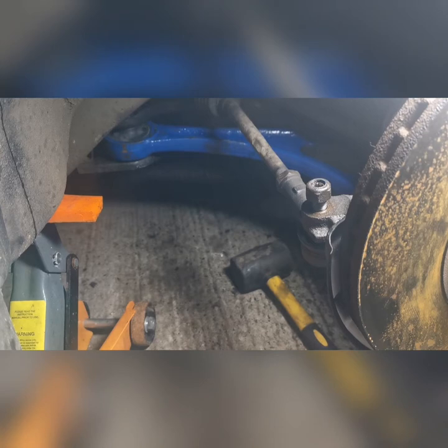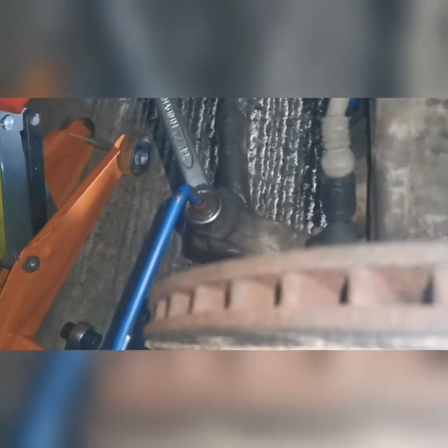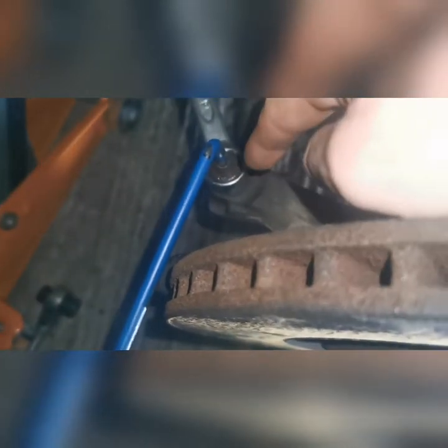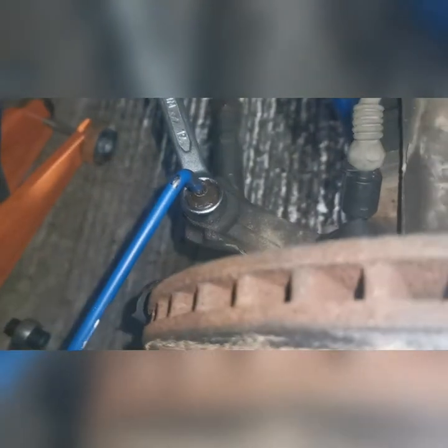I'll be honest — I don't actually know what the torque settings are for any of these bolts; I'm just going to make sure they're tight. I've tightened everything up using the breaker bar. As I was tightening this up the bolt inside was spinning, so I'm using a T40 bit to hold it in place and then using the ring side of the 19mm spanner to tighten it up. After it gets to a certain point it acts like a taper and you'll be able to do it without needing to use the bit.